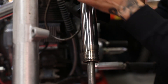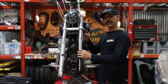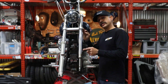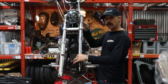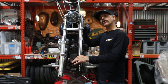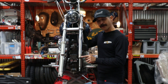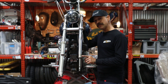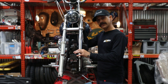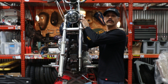Remove the old fork seal and toss that, same with the wiper. So you've got your fork tube completely disassembled, cleaned, and drained. Now it's time for reassembly with the new components. But before we do that, we're going to remove the fork tube out of the trees and install our new components from the top. The reason we install from the top is that on the lower part of the tube there are sharp edges that could hang up on the new fork seal and damage it — if it catches a nick, everything gets assembled and your fork is still leaking. So we always install new components from the top.